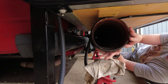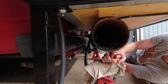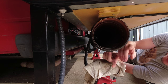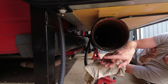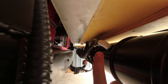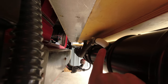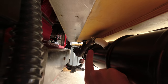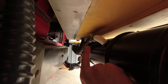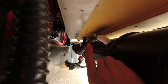So let's just do this, and I add a couple of 20 liter gray water canisters to the truck, so I can empty them into the can and put it in front of the wheel where the storage rack is. There's not much room here, but maybe you can see that's the drain hose of the shower pan, and this is the connection to the gray water tank. I just made a makeshift P-trap by bending that hose. If that doesn't work, I still can shorten that hose and just connect it straight.